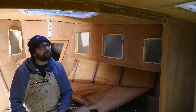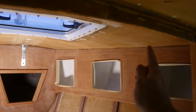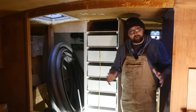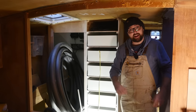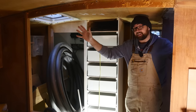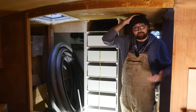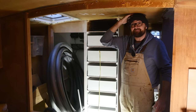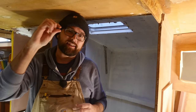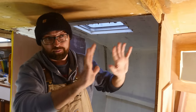For now it is back to the forward cabin and the headliner above the V-berth. The first thing to do is to put up some supports for the new headliner. The height of those are going to be defined by how much insulation I want to add. Above the V-berth area I'm gonna add 19 millimeters of Armaflex. But where I'm standing right now is where we're going to be walking and headroom is at a bit of a premium — I am six foot two, 189 centimeters, and my head is touching the bottom of the deck. Back here I'm thinking about only adding 10 millimeters of Armaflex, but we'll figure that out later.